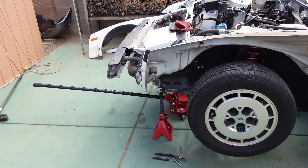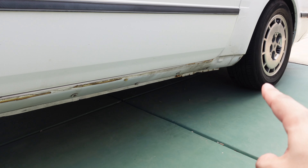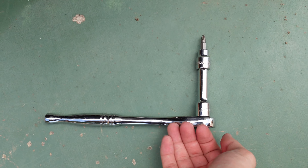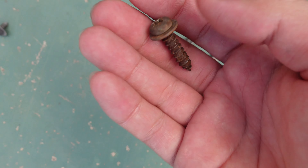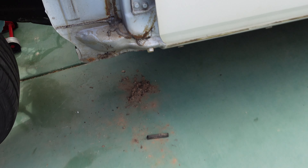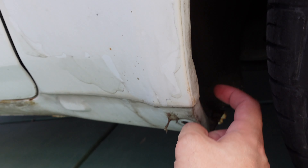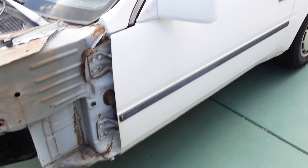Alright guys, we've made some really good progress on these body panels — got the front bumper off, that one's very straightforward, I've done it a lot of times. I've never actually taken the fender off before though. Basically, if you have side skirts you need to pull them off first. You can see mine aren't there anymore. There are about four visible phillips heads — I always recommend using something like a bit driver, pushing really hard and torquing with it. That gives you really good leverage and it always comes off easily. Highly recommend that for super rusty stuff. The side skirt comes off, and then there's a stud through here and another stud back here — you reach them from inside the wheel well, it's just a 10mm nut. Mine was actually a 12mm on the front.